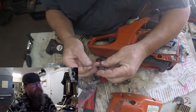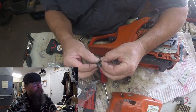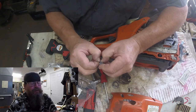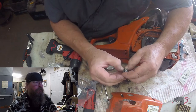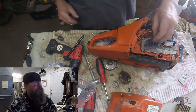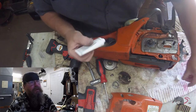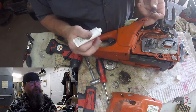Now, this is not uncommon — believe it or not — to open up one of these packages and find a damaged bearing. Normally it's not that an individual roller has fallen out; it's usually that the cage is crushed. There's nothing wrong with the cage on this one — the bearing just popped out of there. I grabbed a smooth-faced pliers and just snapped that roller back into the cage, and it fit on the crankshaft fine, so I know the cage wasn't distorted. I'm not worried about it.